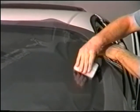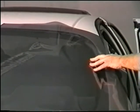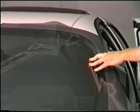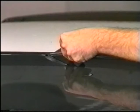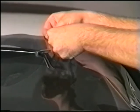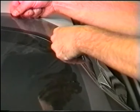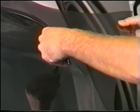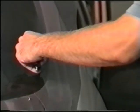The dry shrinking method is fairly new to the window tinting industry. If you master this technique, you will find that it's easier than wet shrinking, and also quicker, and some feel that the film has a better chance of lasting longer. This is because dry shrinking puts less stress on the film. The more stress, the faster the film breaks down.